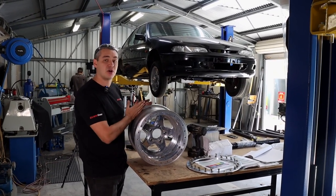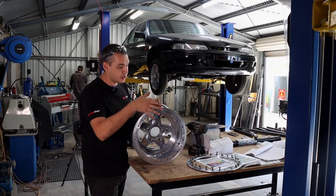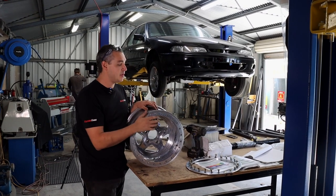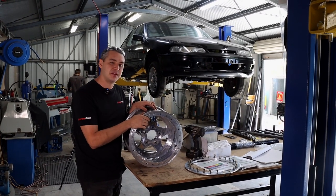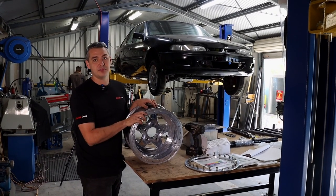So you just slip the tire on, do all those bolts up correctly, evenly. You don't want to do them up unevenly and bend that rim. And then I think it's 20 foot-pounds you tighten them up to, I think it's the general rule of thumb. Once that's done, throw some air in them, away you go.